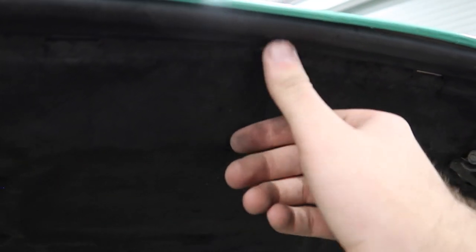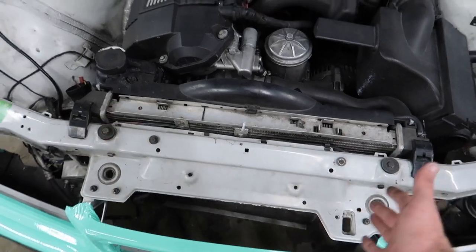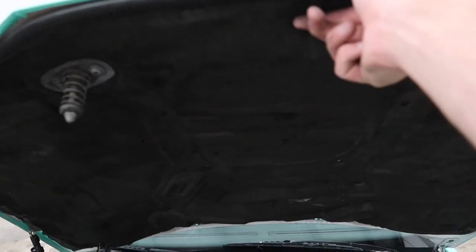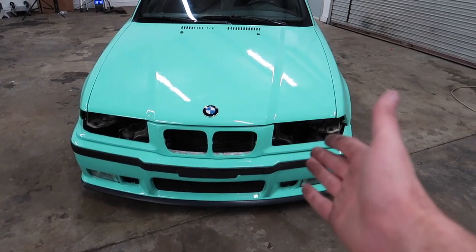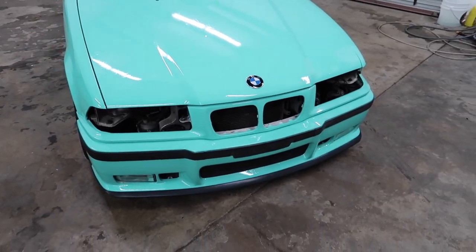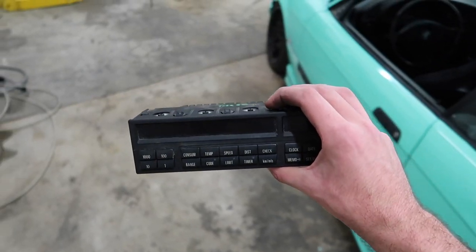It's a little bit sticking out here but it's fine — at least it's all staying up. We also go ahead and throw the missing trim piece on. The engine bay is looking so much better. We finally have that piece there, all the trimming, and a brand new logo. We also fixed the hood latches — they weren't working when I got the car, but it just needed to be adjusted forward. Now whenever I pull the lever they pop up and work perfectly. That is so dope!